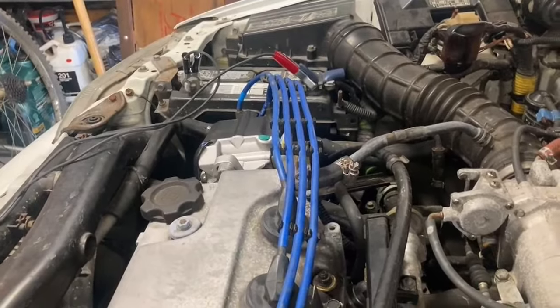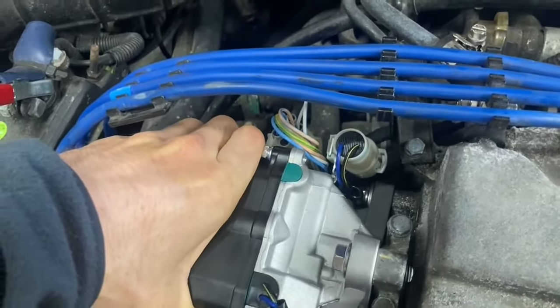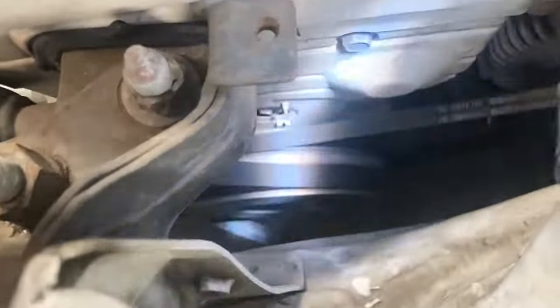So it's not currently in time. I'm going to tilt it — let's go to the right, or I guess towards the rear of the car — and we'll see if that helps. Timing light right there, take the distributor and we're going to do this. I tilted it a little bit that way. Now I'm going to take my timing light again. And that appears to have just kind of made it worse, at least from what I can tell.